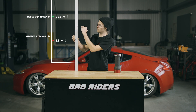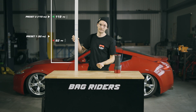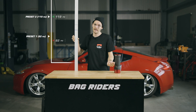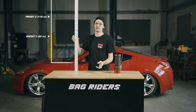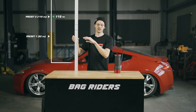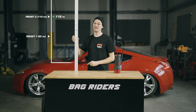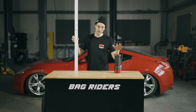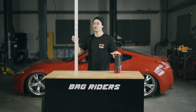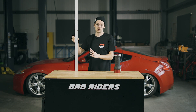So what can you do to not have this problem on your daily driver? There are a couple of options. For one, you could always overshoot before going to your preset — get a ton of air into those front struts and then drop it down. That's probably the least expensive approach but definitely not the best. Personally, I'd go with one of two options: choose a different brand that doesn't opt for a sleeve bag up front. There are a whole bunch of air suspension brands out there and generally, for most cars, Bag Riders carries two to four brands, so just choose something without a front sleeve.